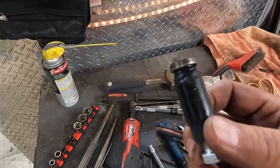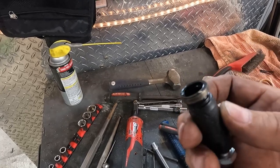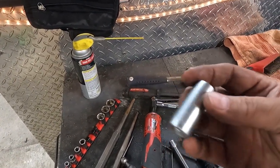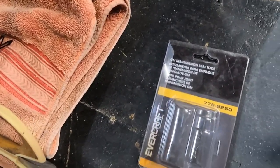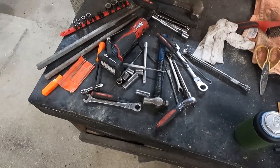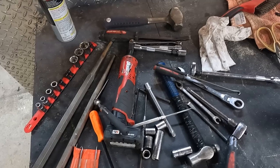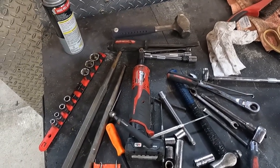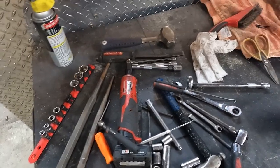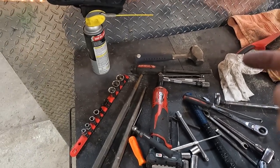Here's the little tool out in the light so you can see what I was talking about. That worked its way into the seal, and then I tightened this down against the shift shaft and popped it right out. It has a little driver to put it in. If there had been a little more clearance underneath there it wouldn't have been a huge issue — I went ahead and had a meltdown. That's the part number on that tool — it's called a GM transmission seal tool. This is all the tools I used prior to that to try and get that son of a gun to let loose, but we got her out. Hopefully that's going to free up our leak. We've got one leak in the transmission cooler on the radiator that we've got to take care of. We're going to align the hood, going to get some exhaust. We're fixing to go on vacation so you all have a good time — if you missed one of our videos, that's why. We're out and about. I'm going to drink this Bush Light. Never forget — drive your shit. We'll see ya.